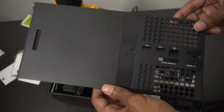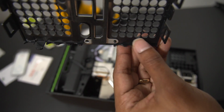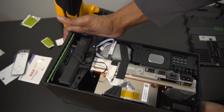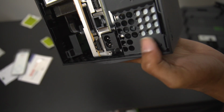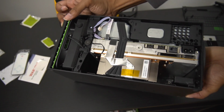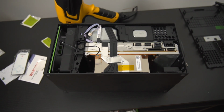Locate your back panel and make sure that you line up the tops with the bottom, and you make sure these bottom clips down here go into those little holes down there, so that the console doesn't overlap and you don't screw some things up or break those clips at the bottom. Very important that you be mindful of this little hole at the bottom here, because you can cause some problems if you do it on the outside, clipping over the case. So you want to make sure it's inside the console, not on the outside. Be very careful with those clips.